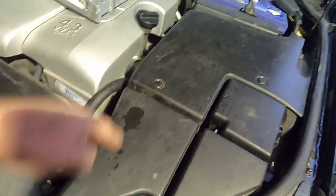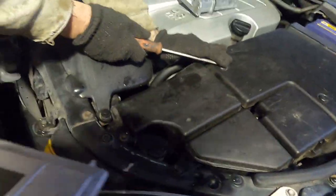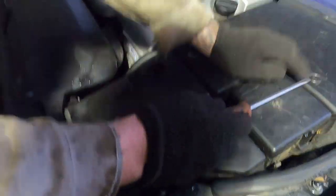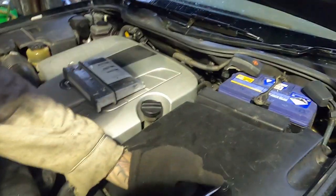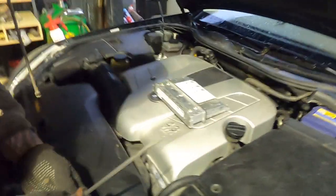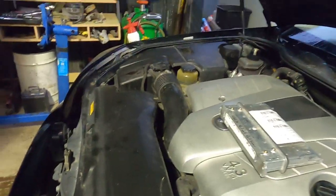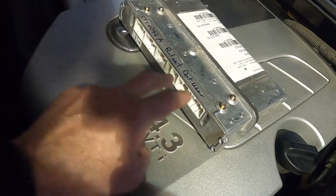You'll take this cover off and remove some screws. It's already full of water so we can't wreck it anyway. This is actually the wrong ECU — it's a different ECU. What we'll do is disconnect the two body plugs first. You don't even need to disconnect the battery. Make sure you're not wearing nylon or polyester underwear — watch that static.